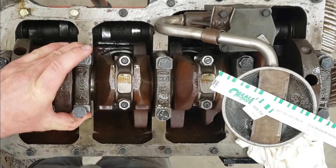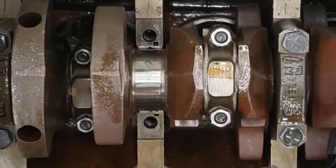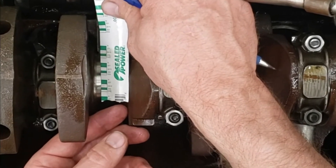Now remove the cap and set it aside. You will notice that the small sliver of plastic has flattened, so hold the gauge on the remaining ripped-off portion and compare the width of the flattened part to the measurements on the gauge.